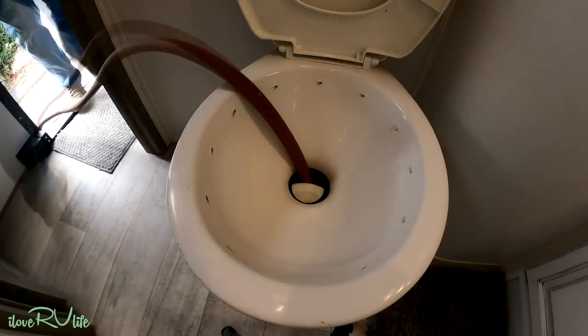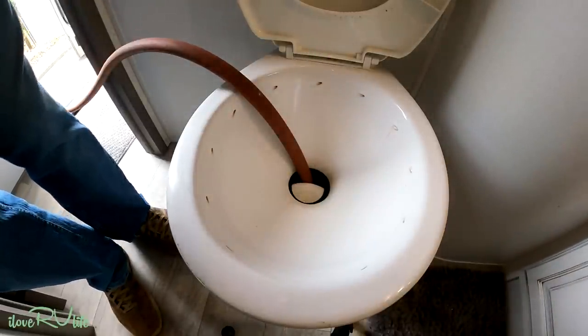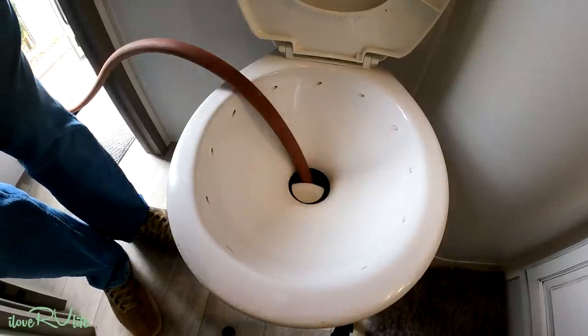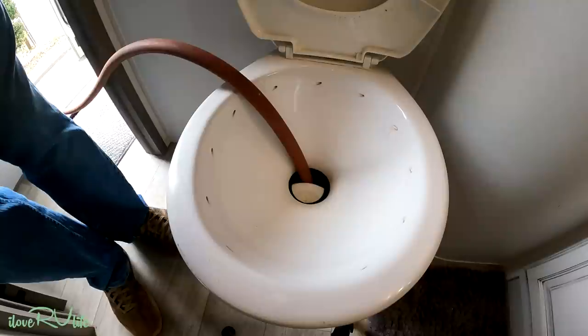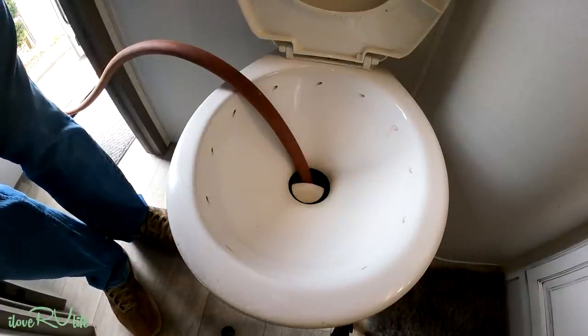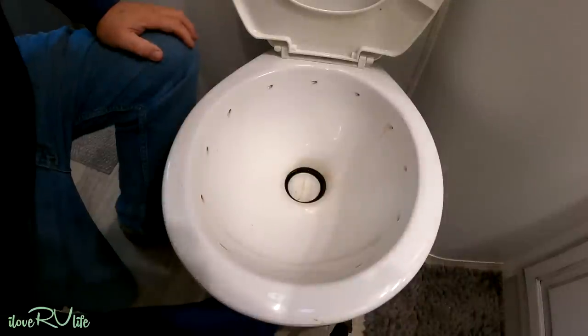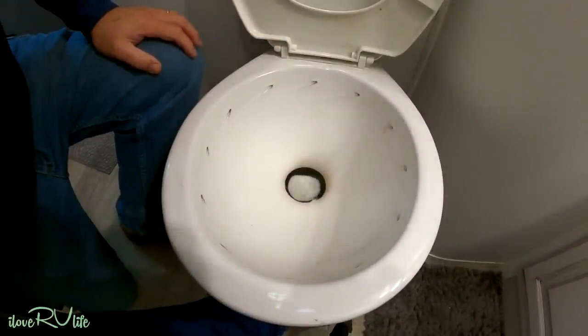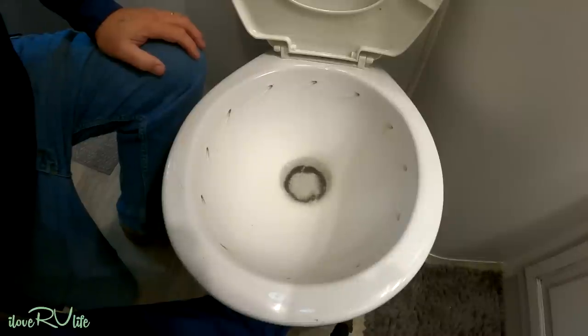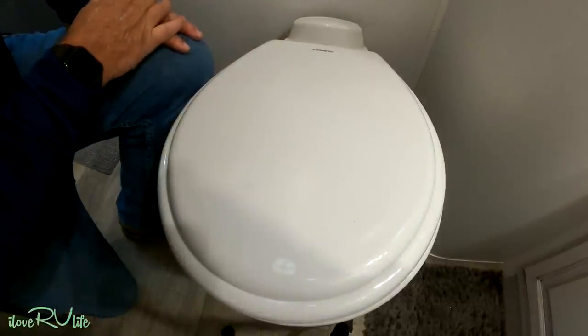Let it sit for 12 hours. This is the easiest way I've found to fill this black tank — I've disconnected the water from the camper and I'm just going to take a water hose and stick it just a little ways down inside there and let's go turn it on. We've got it running now. Some may say putting the water hose down inside your black tank will make the end of it nasty — but that's easy to fix. Take a Clorox wipe or a half-Clorox, half-water solution in a gallon bucket and dip it in. That will kill any bacteria on your hose. We need to monitor the black tank so we don't overfill it — and we are at full. We'll run a little bit of water in here, seal the camper up, and that'll keep any odor from coming inside. Tomorrow we'll drain the tank and see if we get our sensor back.